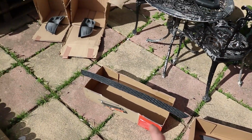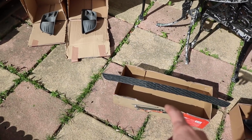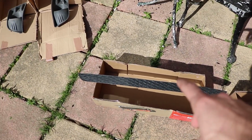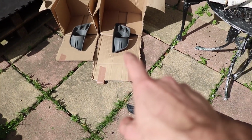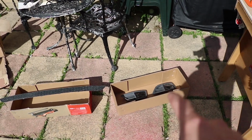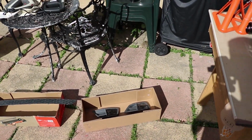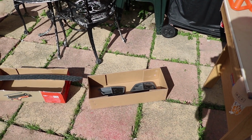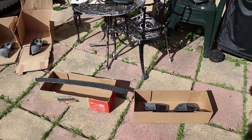Got the rear honeycomb to do some filling, because that's a little bit scratched up, and we got the fog surrounds over there which need the same done as well. So I think we're going to start off with the rear reflector bits first, and we're just going to put a few coats of filler primer on all three of these bits and then see how they come out.